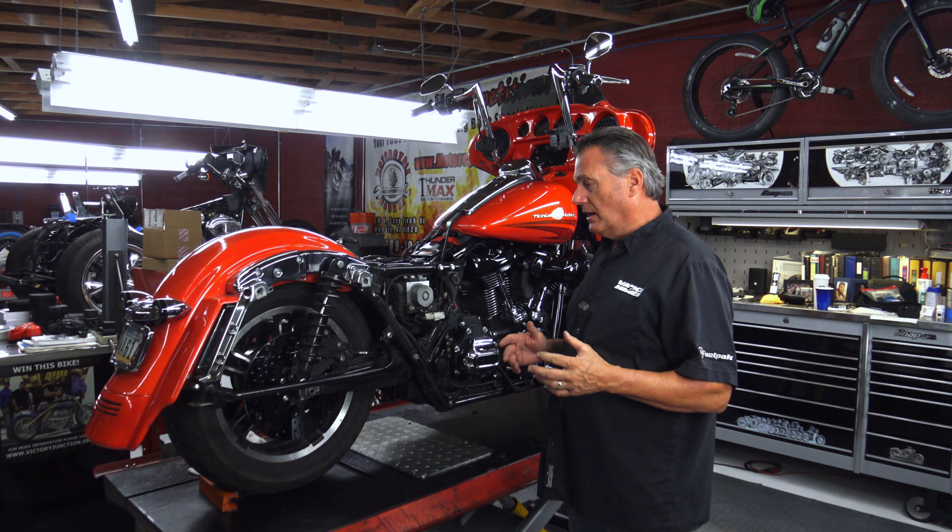Really, all fuel injection is is a fancy carburetor. Instead of a slow speed jet, idle circuit, and main jet, fuel injection uses VE tables — we're dealing with thousands of jets, adjusting them by manipulating VE tables on the dyno. VE is volumetric efficiency at all different RPMs and throttle positions. That's why a good dyno operator is so important, especially when you've changed cams. The Screaming Eagle 8 cam has quite a bit of overlap — more cam overlap creates more reversion and more problems. So again, that's why it's important to have a good dyno operator. A lot of times guys will see this oil and carbon in the intake and think they have a valve problem — do a cylinder leak-down test or compression test and you'll find that's not the case.